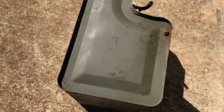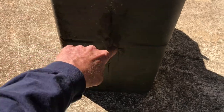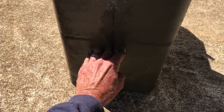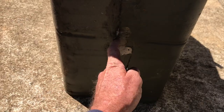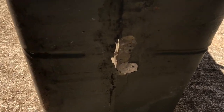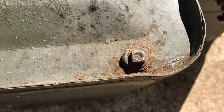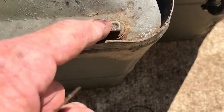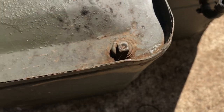Outside with the gas tank, out here on the apron. Unfortunately, this one has some issues — it's been leaking right here. Someone's repaired it at some point, but that's the seam split right there and nobody actually fixed it. We'll have to get to that because I don't want gas leaking into the tub of the MB. You've got this little drain plug right there, and there's still a little gas down in the sump. I'll take that off and drain it into a container. I'll also be flushing this tank out.